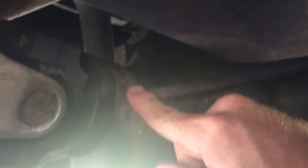What it was was this pinion bearing in here. Inside the diff, there's a bearing, and the easiest way to check is to just grab this and shake it — just like any other bearing, like a wheel bearing. If you shake it and you have play, that's the problem. Right now there's no play; that is the simplest way to check.